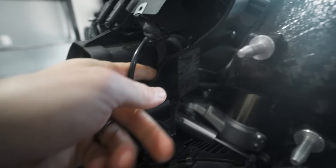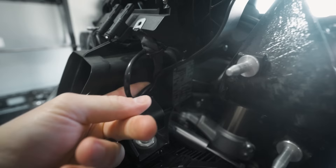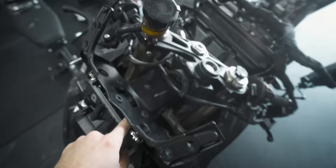That'll save us some time. I started out with that 5/16ths drill bit but had to bump it up to a 3/8ths in order to be able to get that sensor in there. It routes through here — takes a lot of work with your fingers — comes out right between this inlet and that bracket there, and then just goes right up here. You plug in the sensor, stick it in the hole, and the little sensor just pokes down. Now we have that relocation done. I'm gonna go ahead and zip tie it in a couple of different places, put everything back on, and then put on the stage 2 flash, and we should be good to go.